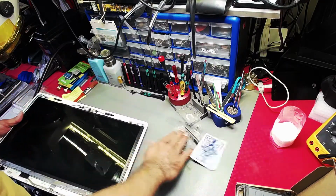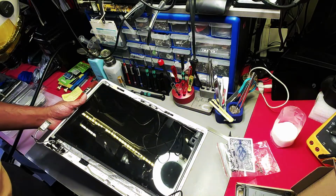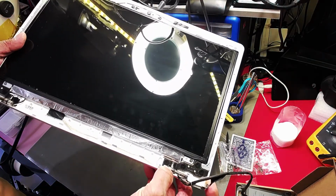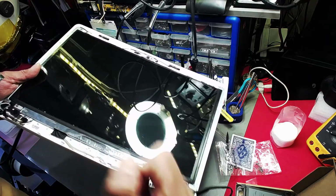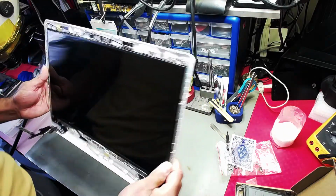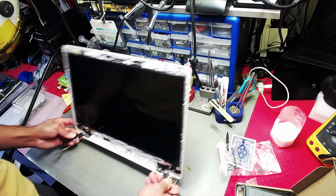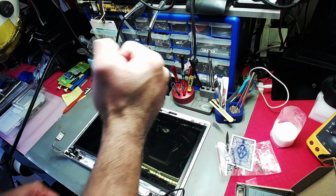So what's the quickest and easiest fix? It's absolutely simple. Yes, you've got to take the panel off, but all you do is slacken those two screws by a quarter turn. Just a quarter turn, not a full turn, little nudges, and see if it's gone a bit loose. Now, this carries a bit of weight, so when it's on the laptop, it needs to hold its place and not drop back. This is why you do these little turns slowly.